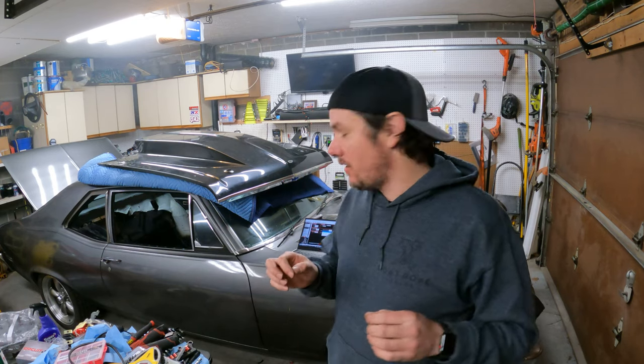We got a couple other small things to fix. The wideband's not working properly, so I need to dig into that. I think I have an idea of what that is — I didn't wire the shield up properly, I know better. I need to go fix that. But at the same time, I think the sensor that I actually installed on this may have been an old one that was damaged. So we'll sort that out.